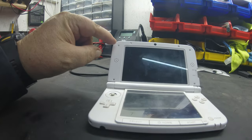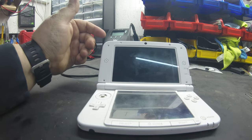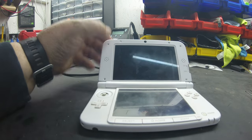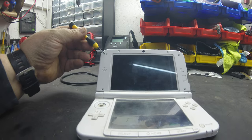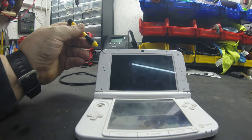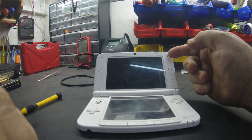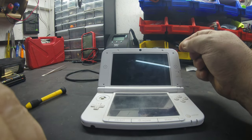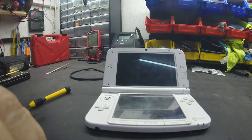The first thing you're going to want to do — which I've already done on this one — is there are four screw holes here, here, here, and here. That's all you need to get the back off the top half of a 3DS XL. There are little rubber plugs covering the screws — use a pick to dig them out. Make sure you get the full plug out, not just the rubber part, or you won't see the Phillips head screw underneath. There are four Phillips head screws in there.